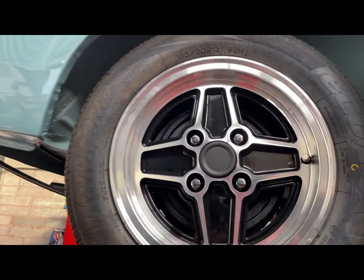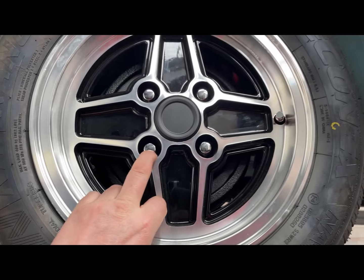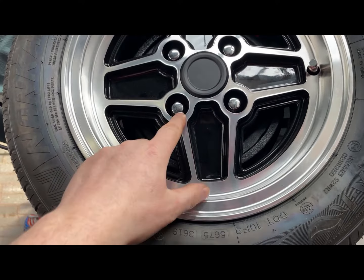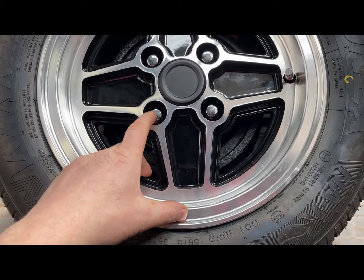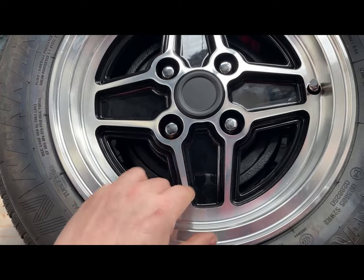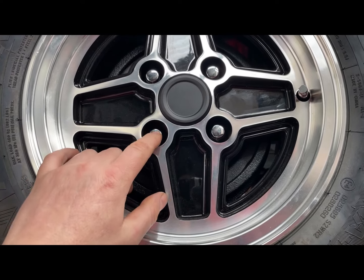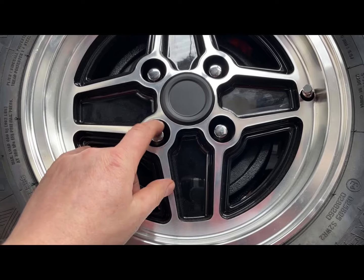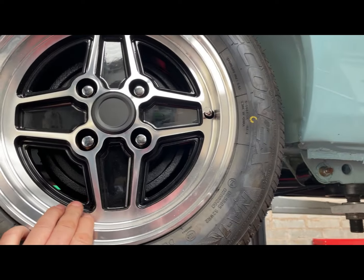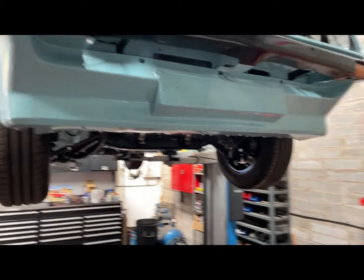That was actually Paul Jackson picking up his steering rack and trunnion ends. So got the new wheel nuts on - just need the RS decals for the centre caps to finish them off. One thing I've noticed with John Brown Wheels and their wheel nuts: on the front we seem to have lots of threads but on the back not so many. If anyone's had this issue before, please comment or get in touch. I could fit longer studs, but I'm not sure if it actually needs them - I'll take them off and measure up. I'm not 100% happy with it so it's something to look into.